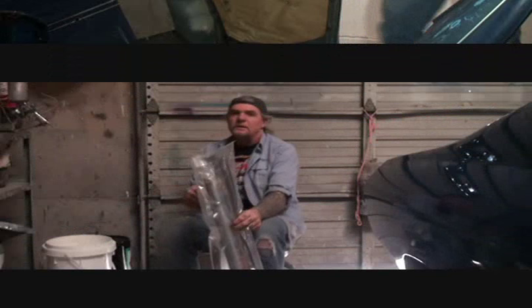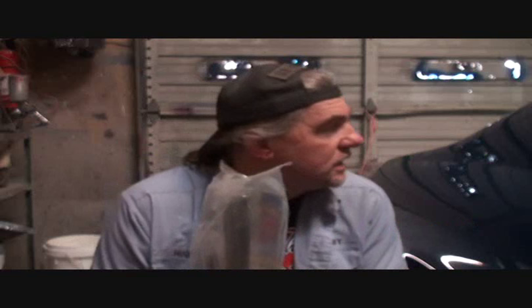Okay, so now that we got the door panels off and the back seat out, now it's time to go ahead and replace that piece of molding. A lot of these classic cars that you see like I'm working on, your muscle car makeover situation, this is how the molding goes on. Now, there's other ways that if you don't want to hassle with taking all that off, you can actually glue those in using some weather strip adhesive, which is a very, very good bonding glue to glue those in. How long it'll last, I don't know.